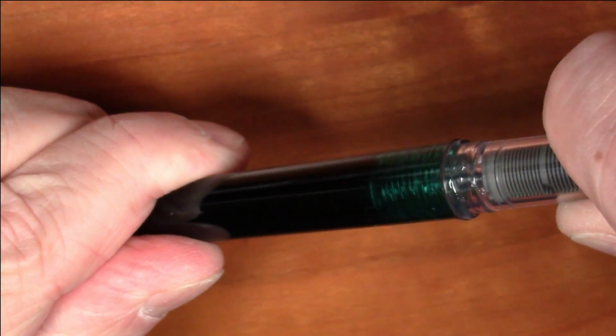the O-ring sort of compresses against the barrel, like that. You don't want to over tighten it. You could crack this. You'll know it when it's down. The O-ring is basically going to compress against the barrel. And then, like I said, there may be some silicone grease oozing out there. You're going to want to wipe off that excess. And that is as simple as that.